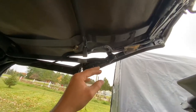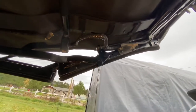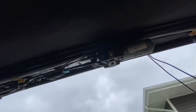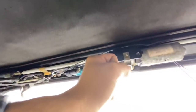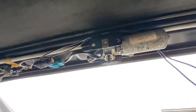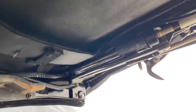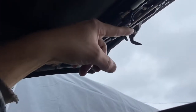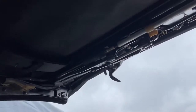That's how people break these roofs — they force it closed with the hinges set wrong and things start bending. Ours is correct. Now you grab a T25 socket and right here on this motor — if you didn't have a fully automatic one you'd just pull the handle and close it by hand, but we have a fully automatic. Put the T25 in there, attach a drill, and start drilling. That will move these mechanisms and start lowering the roof — once it gets there, the hooks will close.